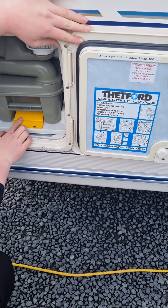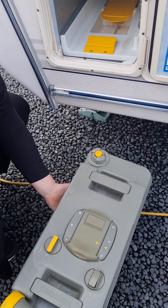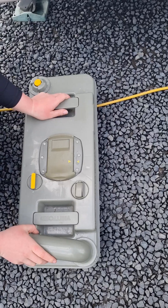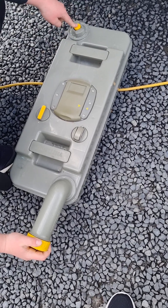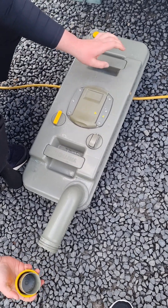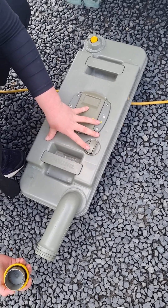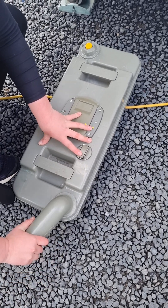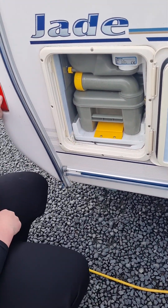For your toilet cassette, when you want to empty it, push this little yellow flap down and slide your toilet cassette out. When you go to empty it, spin the spout out. If you're having trouble getting this cap to release, there is a little air release valve at the bottom that you can push and that should loosen up the cap. You can then drain that out. There is a blue toilet chemical that goes in here — it helps with smell and helps break everything down so it's nice and easy to empty, and you can measure it out on your little cap. Once you've got that all sorted, bring it back to the van, slide it in, and make sure it clips in behind that yellow flap.